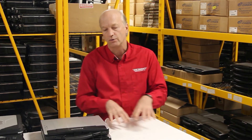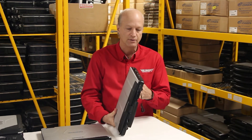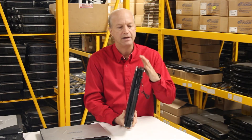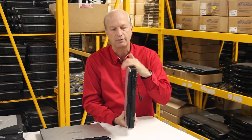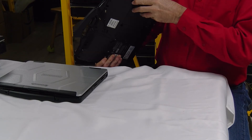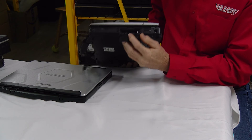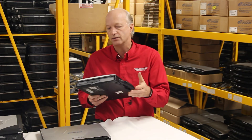Those were our fully rugged units. Now I'm going to talk a little bit about the popular semi-rugged units like the CF-53. The CF-53 — you would think there's a switch on this unit — absolutely. This one happens to be an MK4 standard unit. I do a nice CF-53 walkthrough giving you all the specs as well as some common issues. The Wi-Fi switch on the CF-53 is right behind the door — the PCMCIA door — where you have the SD card reader, and there's your switch on and off. This one is kind of smaller than the rest of them, but definitely an on/off switch.